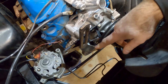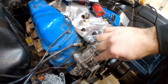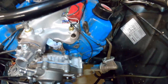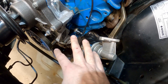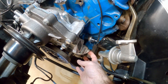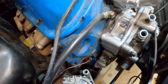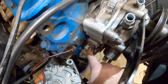Now that all the fasteners are in place, we can start putting the radiator hoses back on. I'm going to run a bypass for the heater hose since the heater isn't hooked up — the hoses were cut when I got the car. We'll put the elbow on and the upper hose on. Don't forget to put the fuel pump back in if you're running that. Also, at the bottom where the timing cover meets the block, there may be a small lip — if you took the oil pan off, take a razor blade to trim that smooth before reinstalling the oil pan. Last thing is to put the dipstick tube back in with some gasket maker on the end.